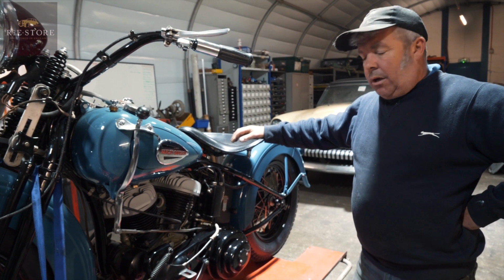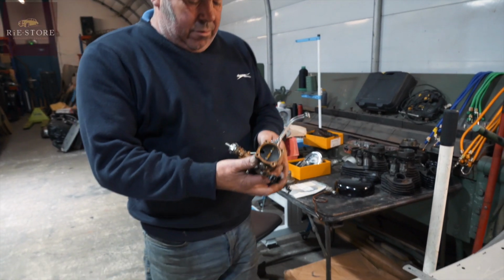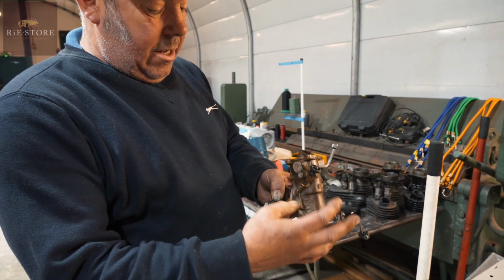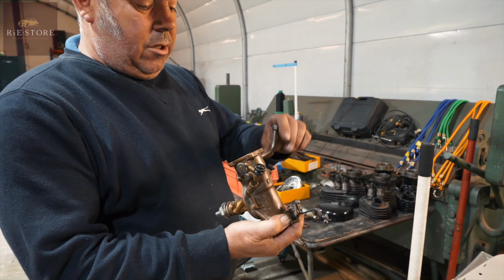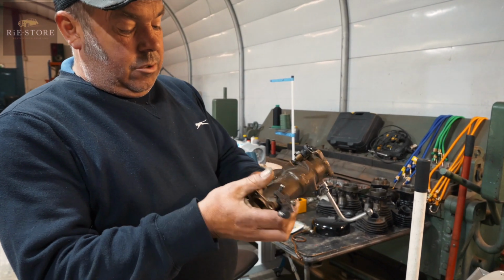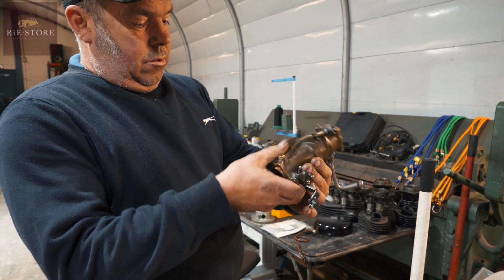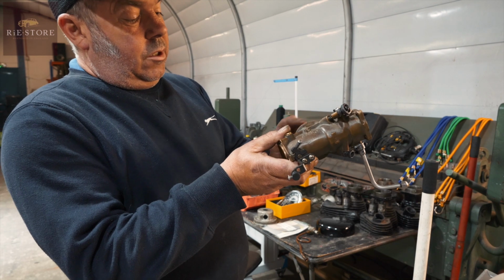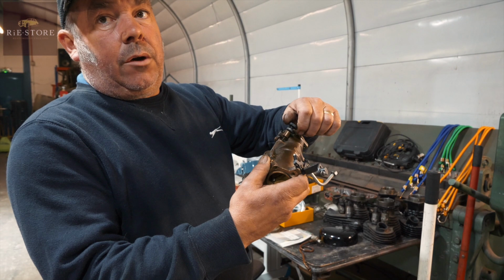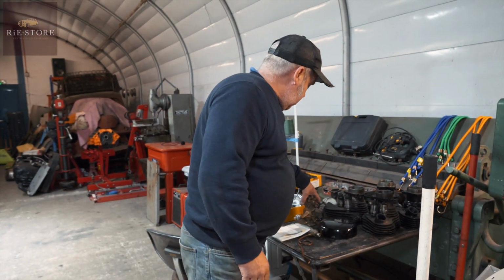Generally the carburetors don't go wrong because there isn't a pilot jet in them or anything. All you've got is your float hanging on the bowl that bolts on there. That's a military style, so you've got a fixed jet in it, and there isn't any primary system on it at all. No idle valve. The idle hole just sucks in through the Venturi. That's your idle adjustment, but that's just mixture. It's not stopping fuel going in and out. So generally the carburetors will go.